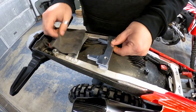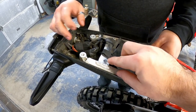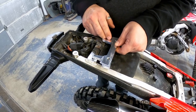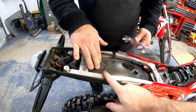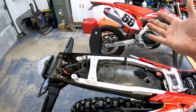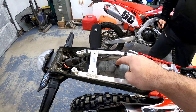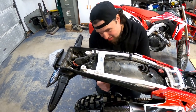This is where your other two bolts go. You have the front and right here, and then these two little bolts go right there. This just fits in tight until it gets to that point and just locks right in there. One of the things we have to do is put four holes through the fender, but we don't want holes in this fender wrong. So we've got to get this part out of the way so we can lay the other part back over and figure out where those holes need to be.